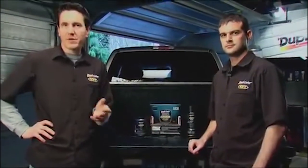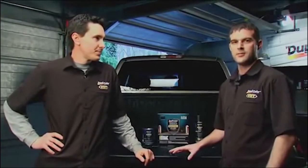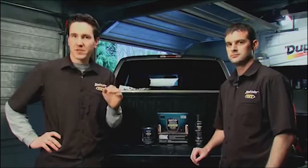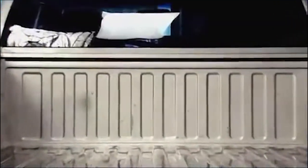The truck bed is all wrapped up — we coated it with two coats of BedArmor, let it dry for about two hours, then peeled the masking tape. Always peel your masking tape away from the project. One of the great things about BedArmor is there's no recoat window, which means at any point in time if we see any spot that needs to be touched up we can go back and do that. Since BedArmor is water-based polyurethane, you can clean the tools with soap and water for future use. There's also no pot life, so once the lid is sealed you can use it in future projects. BedArmor has UV inhibitors in the formula so this is not going to fade.